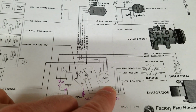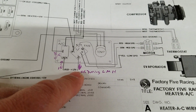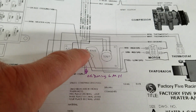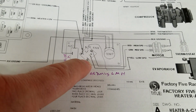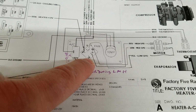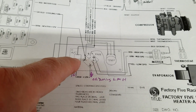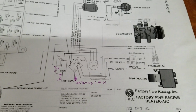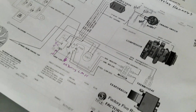Those wires are all for the temperature, and then you've got some power stuff. What's interesting is this is off because it's powered by the fan. So once you turn the fan on and you've got 3 levels going, which is these 3 outputs, the power over here is always on. Once this is in low, medium, or high, this is always on. This actually comes over and powers this switch, and then the compressor will turn on, knowing that there's a fan going and stuff's happening to make sure it doesn't overpower itself or get too much pressure.